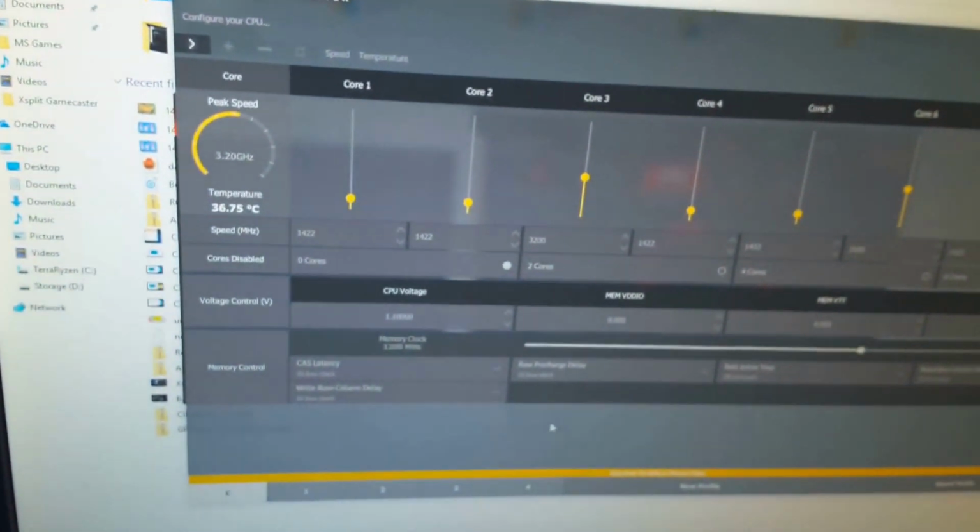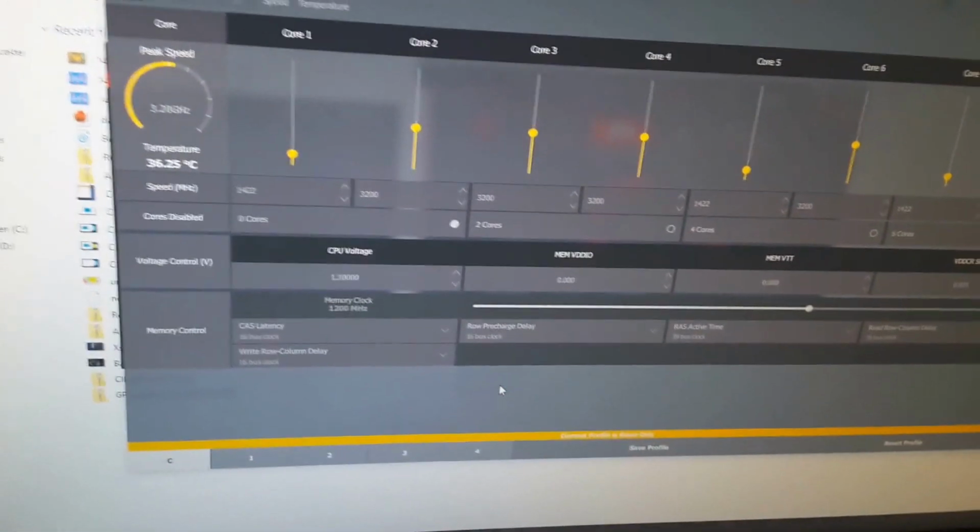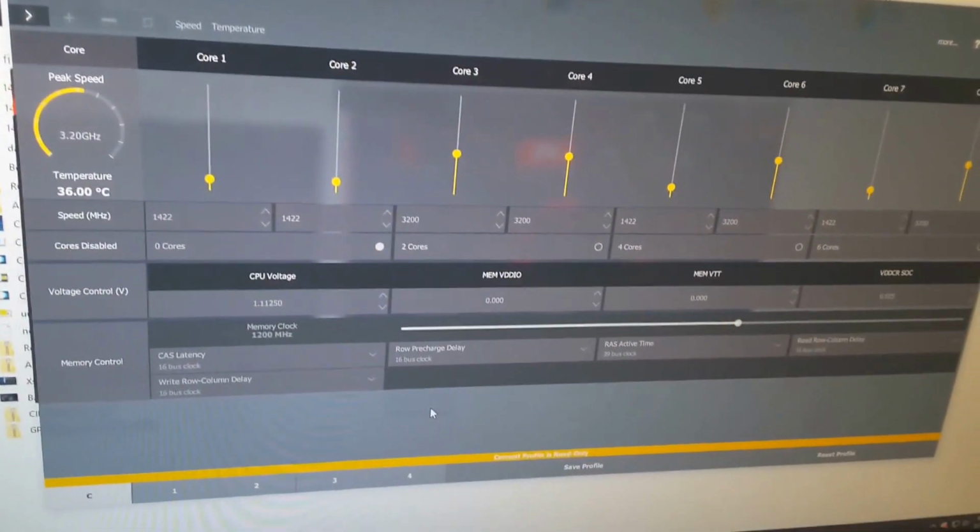I don't see the reason why I should up anything, because I'm not overclocking on this. This is just going to be for media production and generalized gaming. I'm not going to go too crazy with it. So, I mean, it's not too bad. Even at its maximum temperature at 40 degrees Celsius, that's still well underneath the tolerances. But when I'm gaming, I'm sure that dips above 80 degrees Celsius, and the processor starts jittering around there. So, getting bigger case fans for intake should actually help with that considerably. I don't see the reason not. I mean, like I said, I do feel that the stock AMD Wraith cooler is actually quite fantastic.